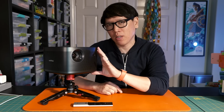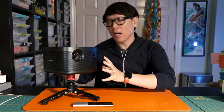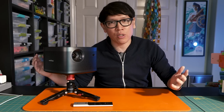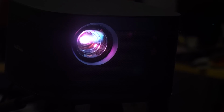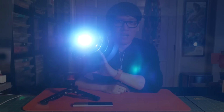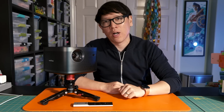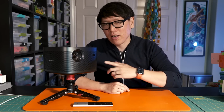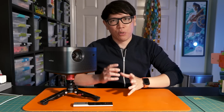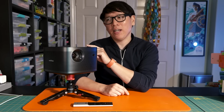And so a manufacturer like Xgimi and the Horizon Pro here controls all the components along the ends of that stack. So from this high 2200 lumen RGB LED backlight that shines through to the optics in the front, to the processing. They're using a MediaTek chip that does all the video decoding as well as runs the Android TV 10 interface here. That's what they're controlling and packaging with the speakers in this unit. And that brightness of the LED light is really important.